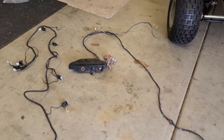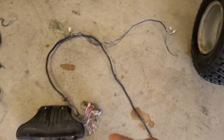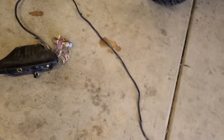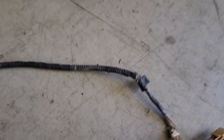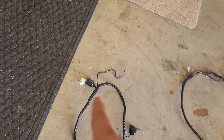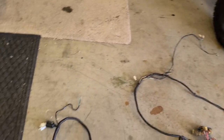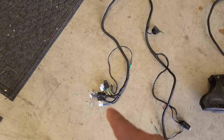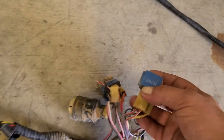So I've laid out the two wiring harnesses. This is the old one over here — those go up to the lights, horns, and turn signals. Then that piece goes over to the dash, and then we come back to what used to be the connector — it connects right there. And then we do have the new one, and it has some funky connectors here that aren't matching up with anything on the front end. It's got two wires there instead of the six or so for headlights and horn. I got a random one in the middle there and this is what they gave me for the dash which doesn't line up — doesn't have the right connectors for the relays.